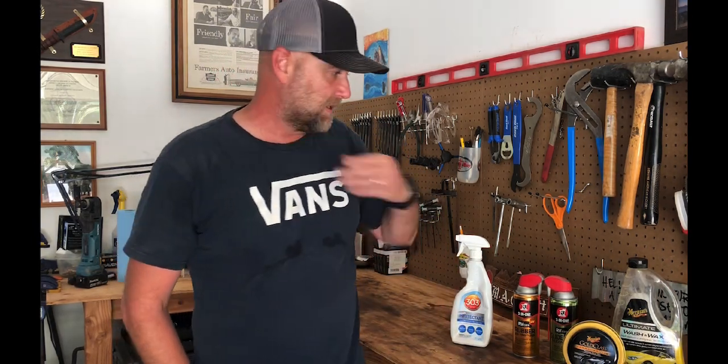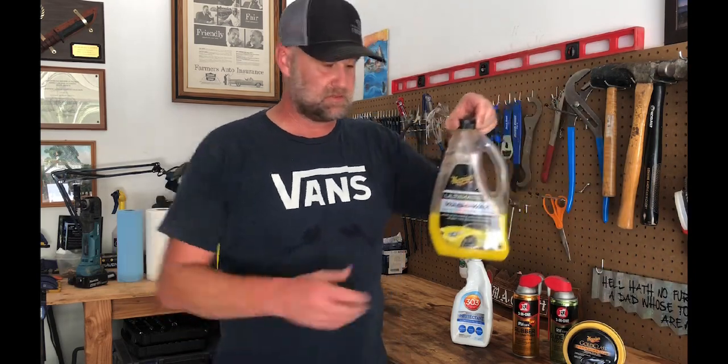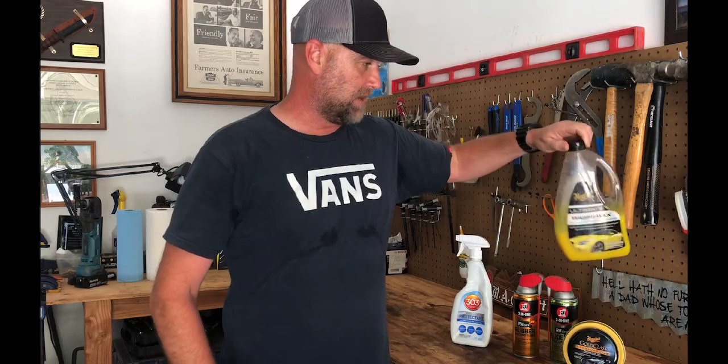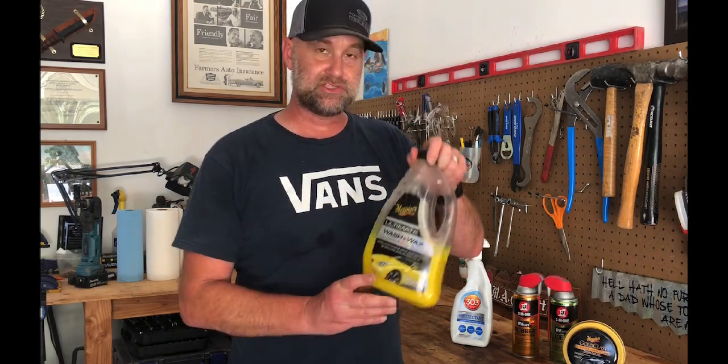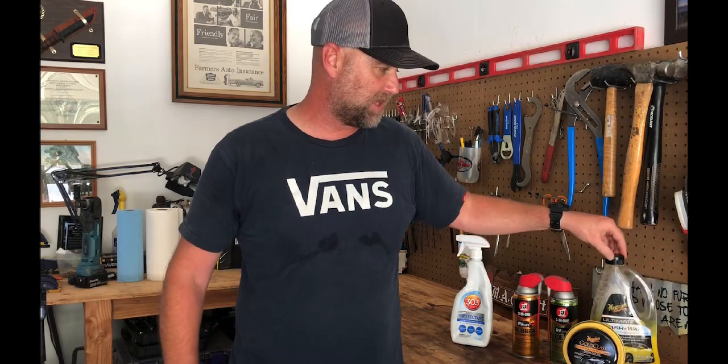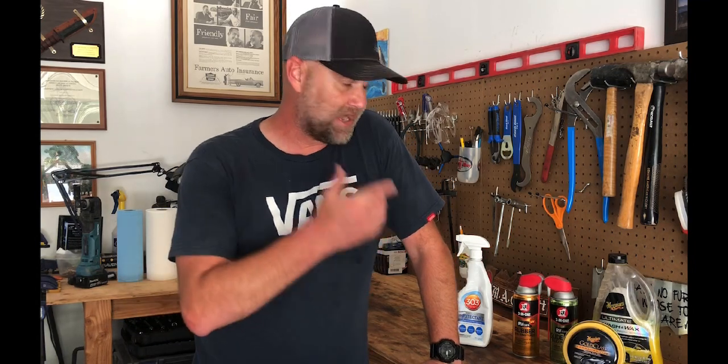I've tried a couple of different methods. I started out using Meguiar's Ultimate Wash and Wax, which I like and I still use. Just a disclaimer: don't use it on the roof. Any product with wax in it, any wash with wax in it, don't use it on the roof of your trailer because it will cause the roof membrane to bubble and separate. I was using spray-on wax for a while because I thought it would be too hard to do a paste wax with the corrugated aluminum side of the trailer. That was okay, but I was still getting some oxidation, especially on the decals on the south-facing side of the trailer where it gets the most sun.